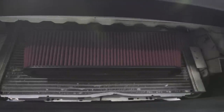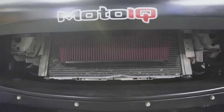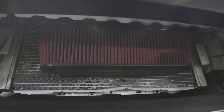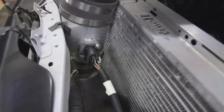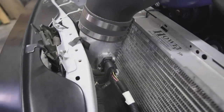You can see the intake up here too. It's almost like a ram air type thing, which actually isn't good on a mass air flow engine because it can cause a lot of turbulence, especially with the mass air flow sensor so close to the front of the air filter. That turbulence messes up the air flow, which messes up the fuel-air mixture and your car doesn't run right. So we're gonna fix that.